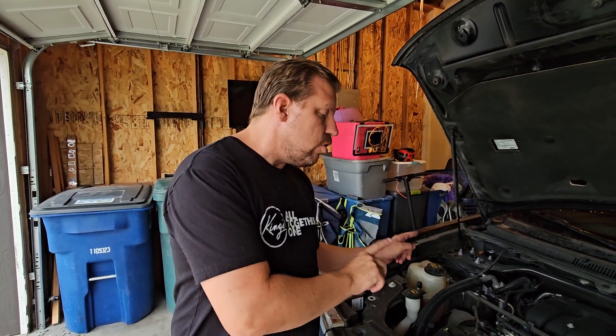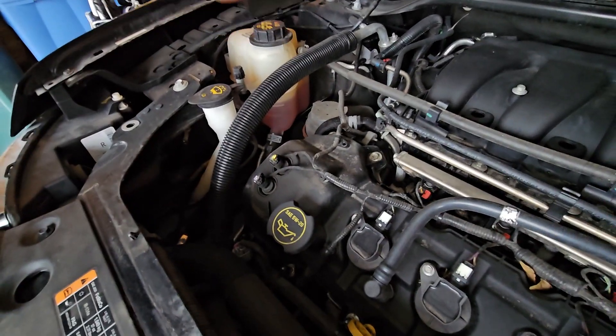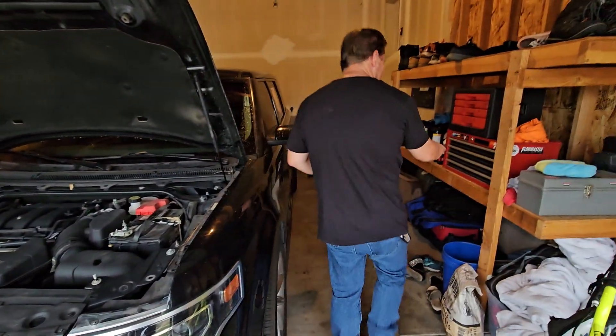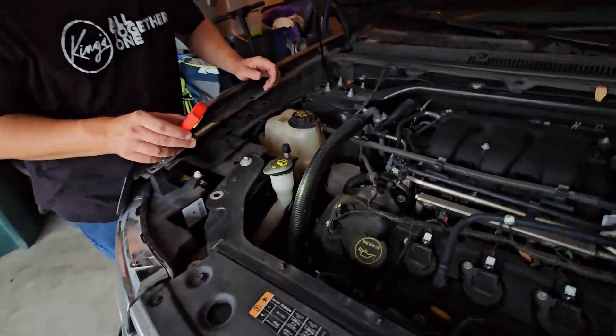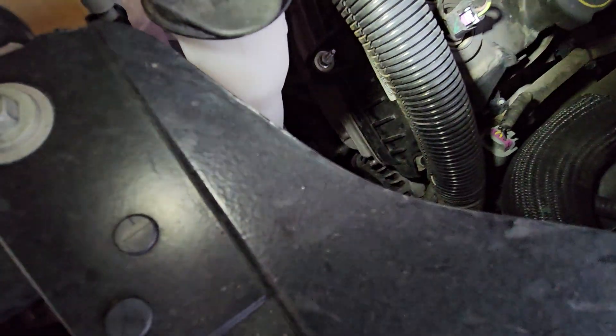Number two preventive maintenance: besides making sure the oil has been changed every 5,000 miles, always, always keep an eye on how much coolant you have left. Every time you get an oil change — in fact, even between oil changes — always check the coolant level. If you start seeing it drop, you may have an issue. What Ford has done with this water pump, knowing it's driven off the timing chain, is they actually provided a weep hole right on the side of the engine. Right behind the alternator, there's a weep hole, and you can periodically check it to see if there's coolant leaking.